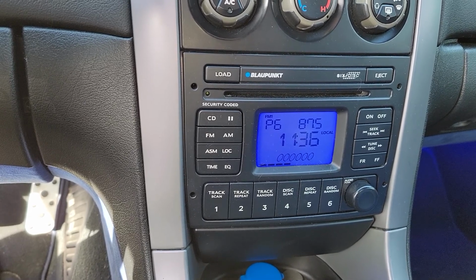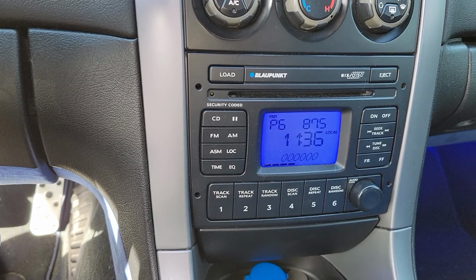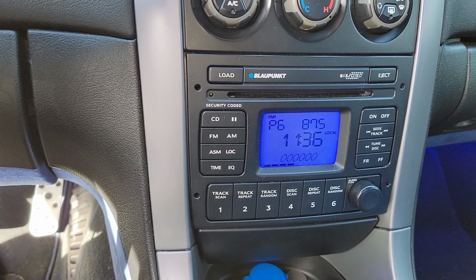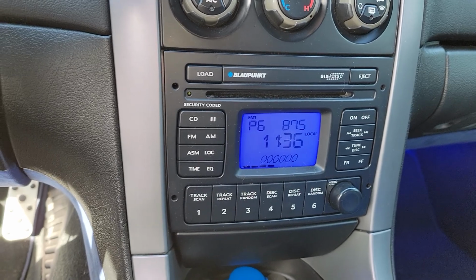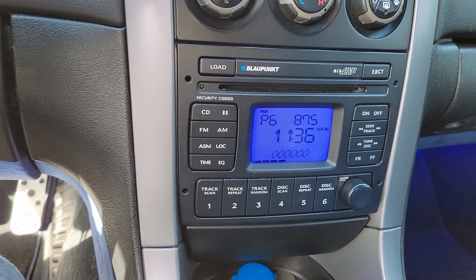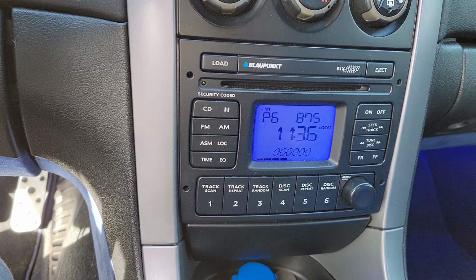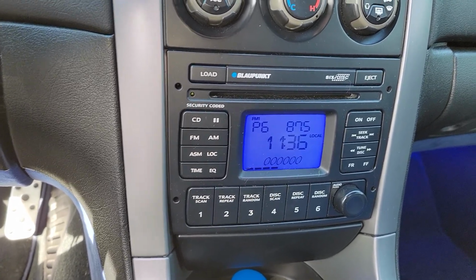I mean, it's possible maybe my thermostat's a little stuck. Maybe the gasket that goes on the thermostat is allowing water by. I don't know. It just takes too long. No other car I've ever had takes this long. My wife's car has an elevated reservoir and a closed system, and it does not take this long. She gets heat within, like, I don't know, a minute, and this thing takes, like, 10, something like that, which is annoying in the winter.